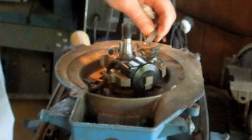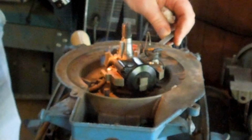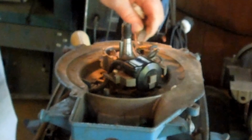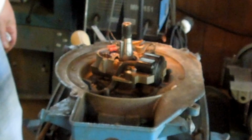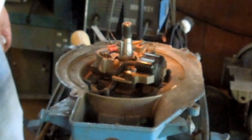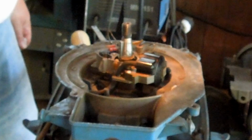Carburetor's tied into a spark advance. With it on idle, the ignition is fully retarded, or set back. With it on wide open, the ignition is advanced. Interesting. My old Harley 45 had an adjustment on the contact points. You could rotate the contact points for starting. That way you didn't end up launching yourself over the handlebars.